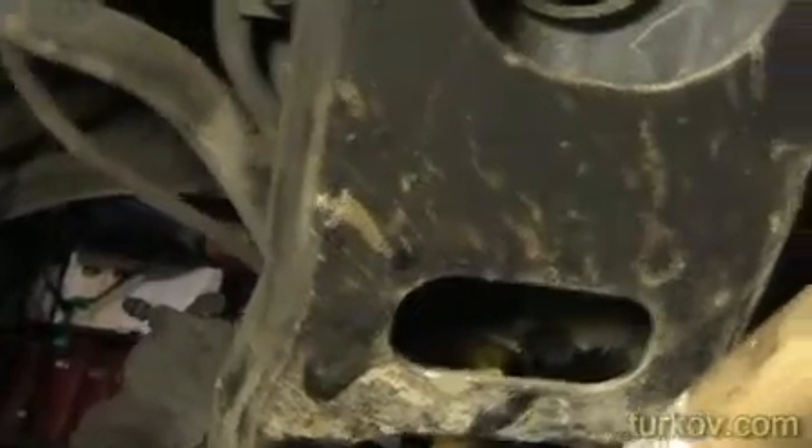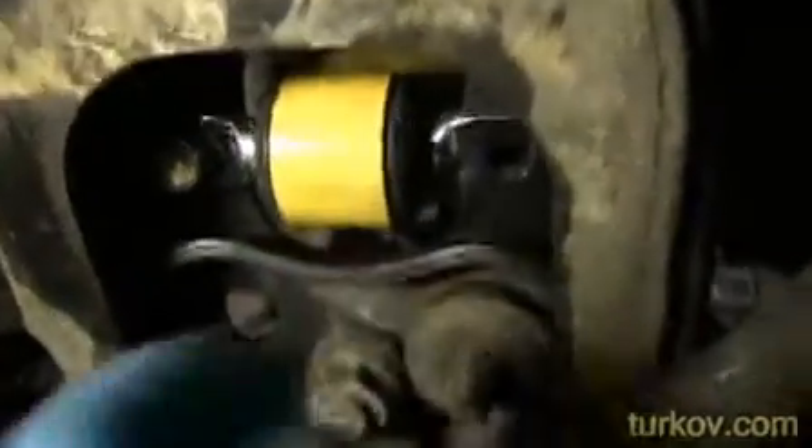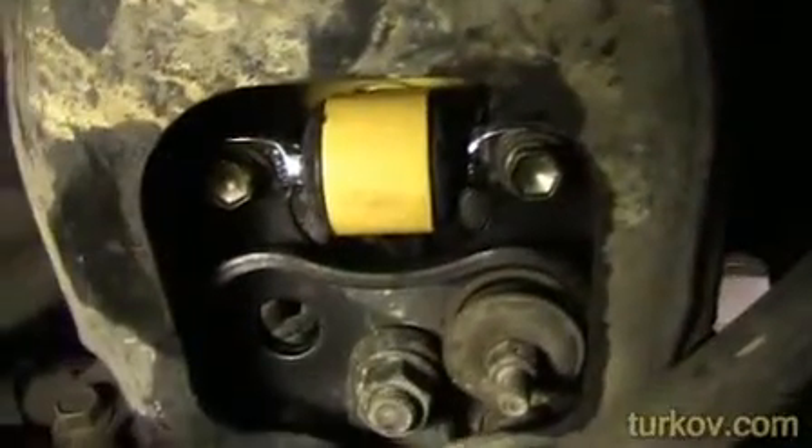All right, let's loosen the floor jack. Now that we've removed the jack, we have that one bolt holding this shock in. We're going to screw the other bolt in — really straightforward process now. You want to alternate sides so that this thing goes in evenly. You can actually look at the top here and see how far up the bolts are coming up.